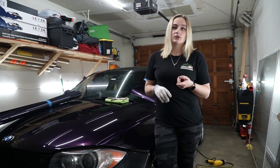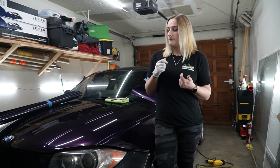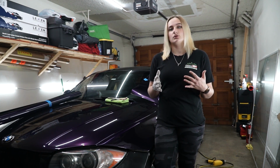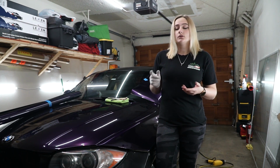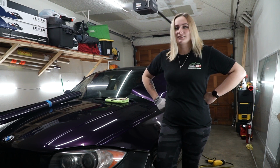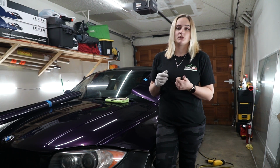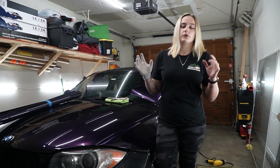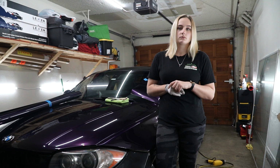There are a couple pros and cons for VinylFrog. Some of the pros: it's definitely got a lot of colors. It's got such a high gloss to it that it almost reminds me of Inozetek, which, out of all of the vinyl film products out there, is the most glossy. So definitely a pro for that. Oh, the other pro is definitely that it also shrinks on itself. It is a pre-stretched material on the roll, meaning that when you lay it cold, for example, it'll shrink to the edges and wrap itself around, unlike most cast material films.